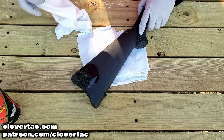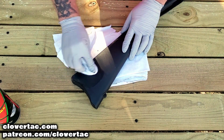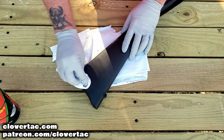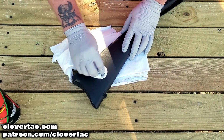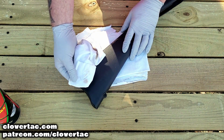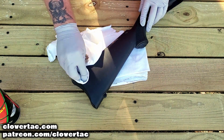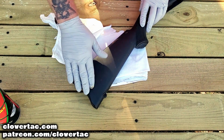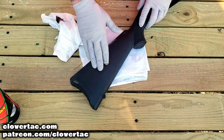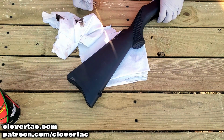And spray it on there, let it sit for just a second. Let's find us a clean spot on the rag. Wipe that puppy down. Let's see if we got any residue. If it's harming the plastic here, we should have something on the rag, and really we don't have anything on the rag there. So it looks like the synthetic, the polymer here, fairly impervious to any ill effects with some of these automotive cleaners.